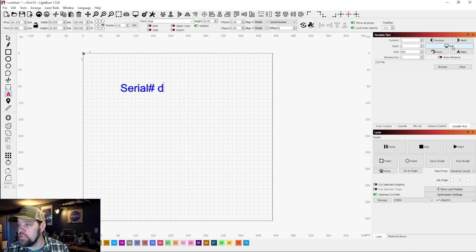If we move to the next job it would show one. That's great for adding serial numbers sequentially, but for a broader range there's some formatting to consider. If we're going from zero or one up to 999, you probably want to start at one. We'll want three digits so we type 'ddd'. When you test it, it still only says one. If you want it to display leading zeros, add a zero before the d's — now when you hit test it shows 001.